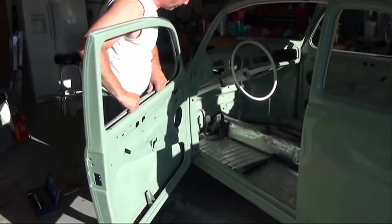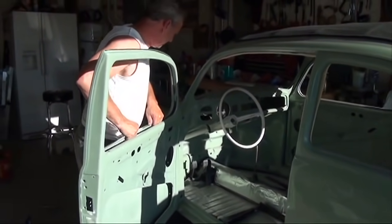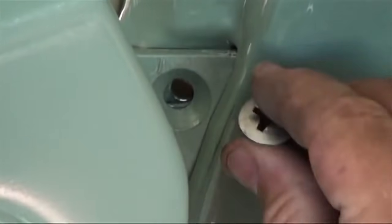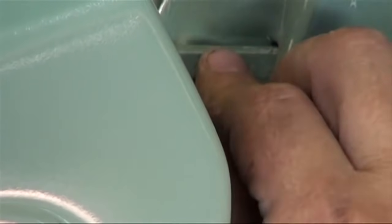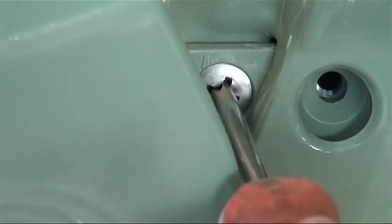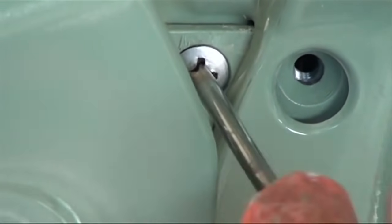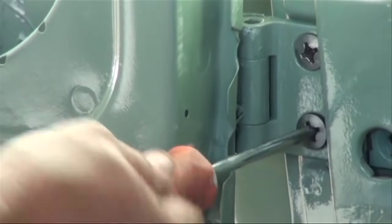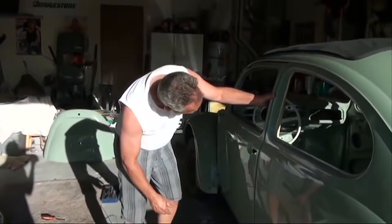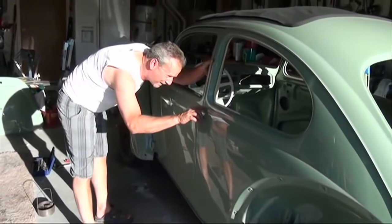We installed the doors. I was able to get most of the old rusted bolts out that I had to drill out to remove the doors in the beginning. And those that I didn't, I drilled out and re-tapped with the proper tap, so I was able to get them all lined back up again. Originally, the door hinges were frozen shut, and I had to use a little heat and finesse and oil to work them free again, but now they work very well and fit very well.